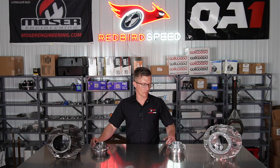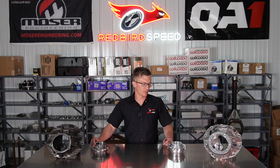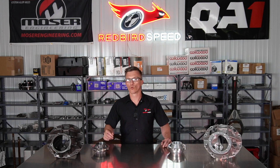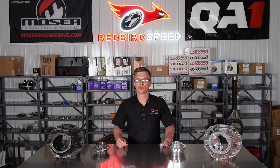If you're buying a setup kit or something like that, you need to make sure the setup kit comes with the Daytona style bearings, because you don't want to have any kind of fitment issues. These come with instructions that tell you bearing and race part numbers and give you a little bit of guidance about warming up the support and putting the race in the freezer to get them in there easier.